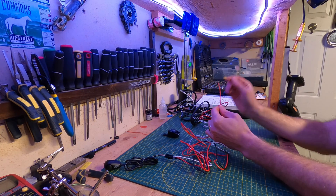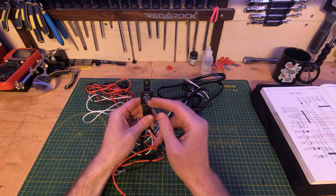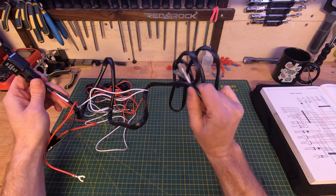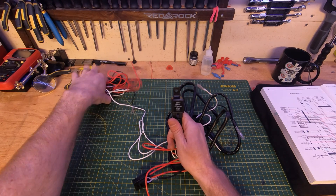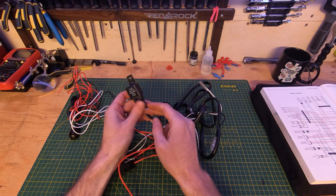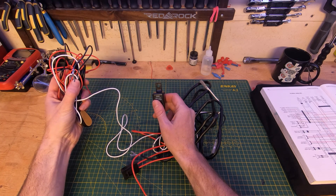The other side is just an empty piece of wire that you would tap into the headlight wire for your low beam headlight, license plate lamp, or rear taillight. I like the headlight for auxiliary lights because it's up front. The relay has a coil with normally open contacts — when that coil is energized, those contacts close, completing the circuit from the battery out to the LEDs. The power that energizes that coil comes from the headlight line — that ignition current. When you push the handlebar button, you energize the coil, which closes the contacts and gives you power to the LED.